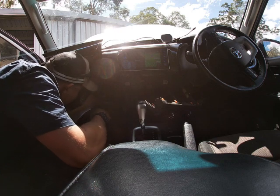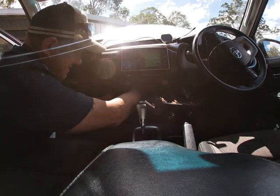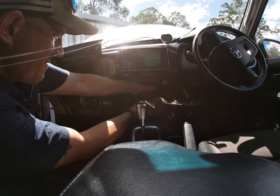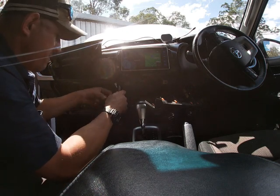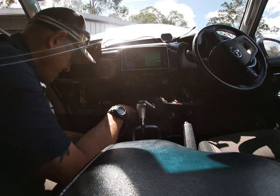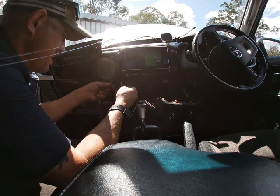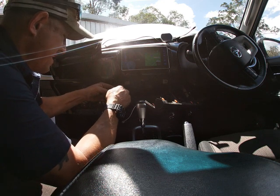There's a little sneaky hole there. There's no reason that's going to hit on anything or disrupt anything. Bring that out through that hole there. Beautiful. There we go. Get all that junk off my hands. And then we knew that black was to black. Okay, so that was the black. Blue was the lights, which we're not using. And then green was output. And that was input.